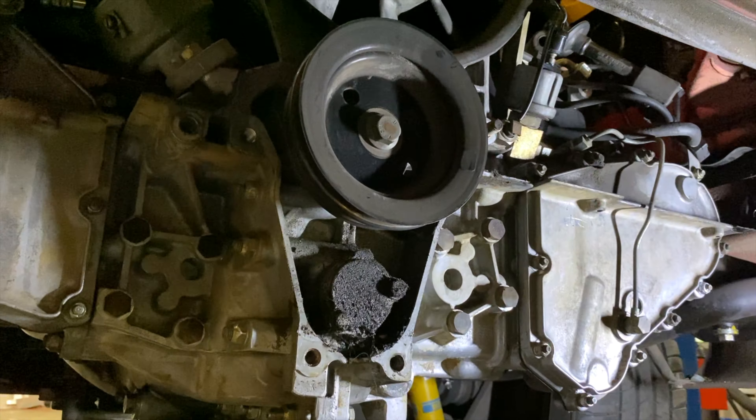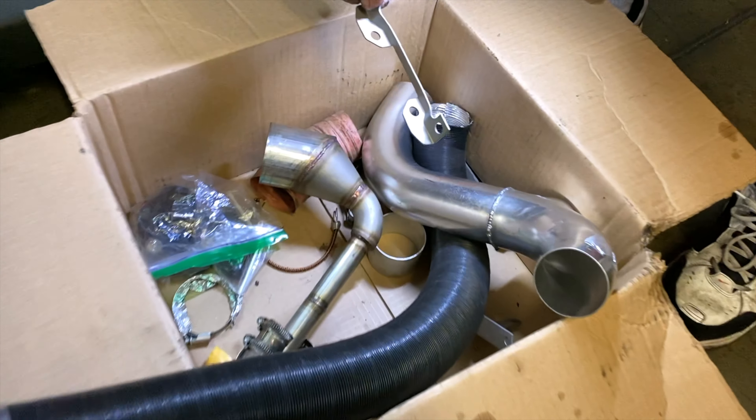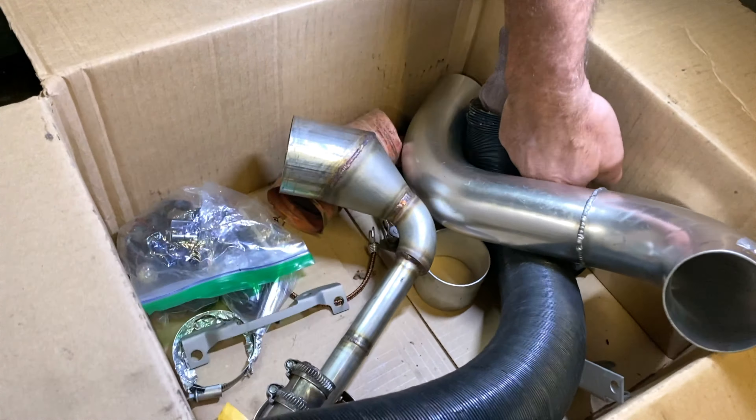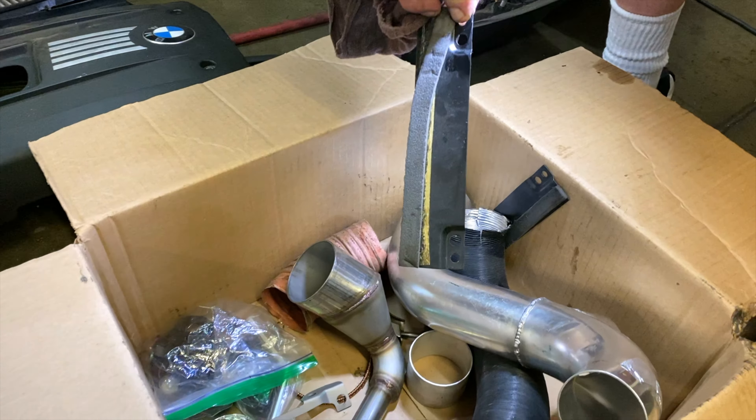I've already changed the pipes, already did the plumbing on it — got the crossover pipe in the rear and then the oil line going back over to the oil thermostat. Are we missing any parts? No, there's a couple pieces in here but I don't think they're going to go with this — like this bracket here and these pieces here. These appear to be something for maybe air conditioning, where they converted the AC on this car. You've got lug nuts and license plate lights and stuff like that, just a couple of miscellaneous brackets and pieces that don't go with the exhaust.